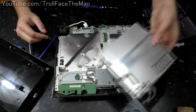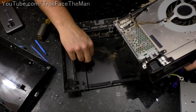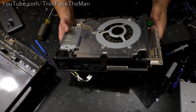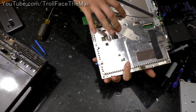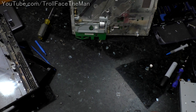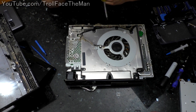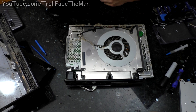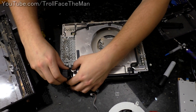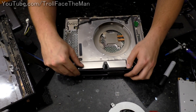I'm going to dig a little bit deeper in here and try and get down to the CPU. Things are a little bit dusty in here — clean that out. So we can actually finally see the CPU and GPU. You can see these are the mounting brackets on this side, but I'm going to have to take off this fan here to actually get at them. I think I'm going to even need to take off this entire cover. It looks like I could have left the fan and I just wasted effort doing that. This is exactly why I am not making a tutorial video on how to do this — the proper way definitely isn't the way that I'm doing it.